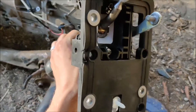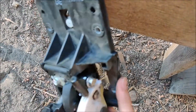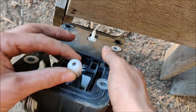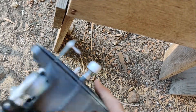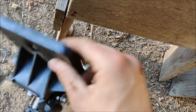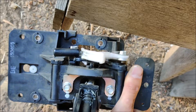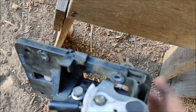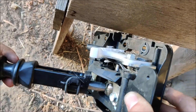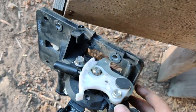It's kind of hard to show what I'm doing one-handed. This is going to do the back and forth movement right there. So here's that back and forth - that's pretty easy to wrap your head around, right? It's just got this little plastic spacer grommet, whatever you want to call that thing, that drives the forward-back. And when you start going side to side you get this really cool motion here. So that's coming from this shaft right here, it comes off the side of that ball there - see how it comes vertical - and it's got another ball and another socket there. Makes a forward-back motion, so that's pretty neat. Then it's got this ramp thingy here, pretty simple reverse lockout, and that ramp makes it want to pop back. I think this thing's pretty cool.